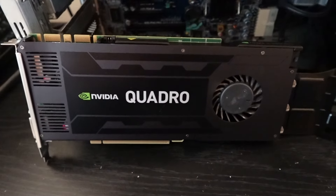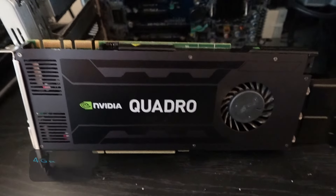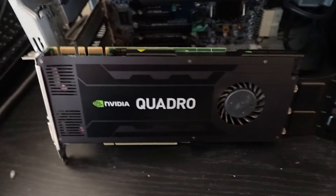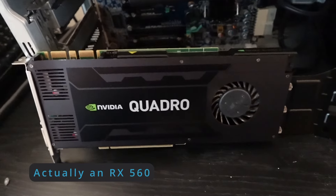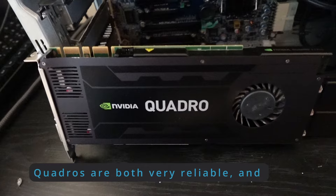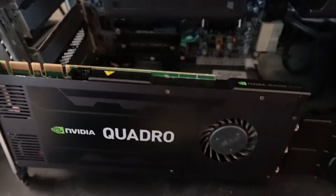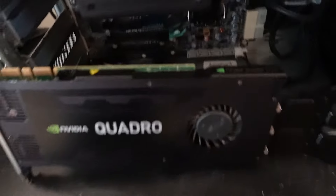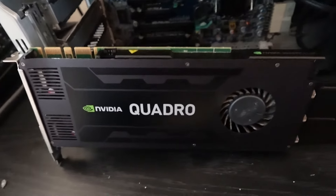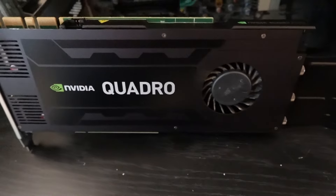This beast of a video card does take a 6-pin external power. It's about 100 to 110 watts of power. It has 4 gig of video memory, and it is the equivalent of something just less than probably an RX 6400 — we will test that later. This is a single-slot card, single-slot full-size, which means I might be able to use it in builds where I have a hard time fitting a card. I do have a little concern with power, but some power supplies might get away with an adapter. The GTX 1660 and RX 480 or 580 comparisons will come later, though performance will be quite a bit less than those cards.